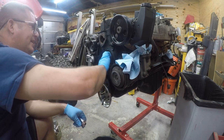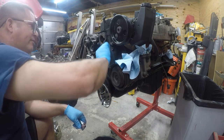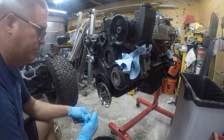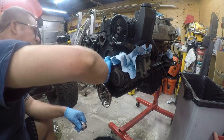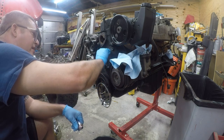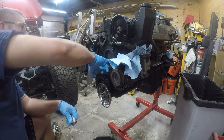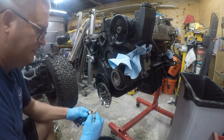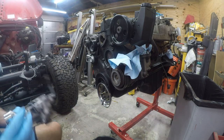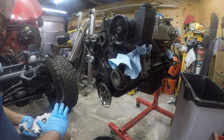But skim coat means I just put that little teeny tiny drop halfway around the pump housing. So I'm going to use another little bead, very, very small. That's a skim coat. And now I'm getting the excess sealant out of the hole. Alright, now I'm going to do the same thing to the pump. I'm going to put a very small skim coat in place on the gasket surfaces.